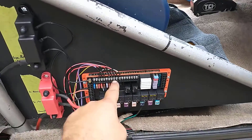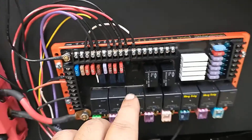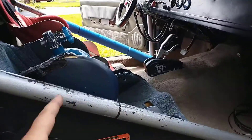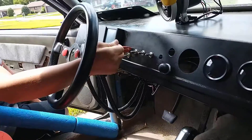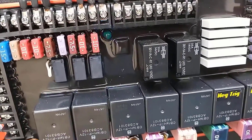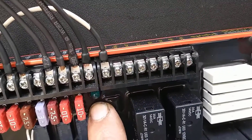Once we click that button you'll hear the relay fire — there's a light right underneath here that lights up to confirm we have a full connection to the trans brake, and then you should hear the trans brake click. We're going to turn the power on and show you how that works out. Power on, fuel pump priming. He's going to press the button — click, click, click. The light is lighting up when he presses it. It's showing that it's working perfectly.